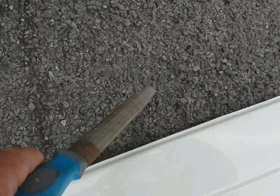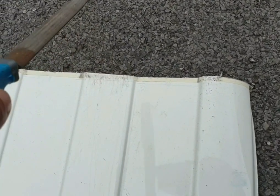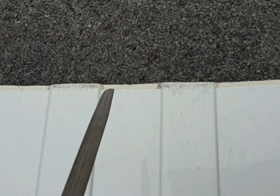And then it was 60 millimetres from the edge of the inside gutter in all the way around. Because this is a long wheelbase version, you don't take the last strengthening beam out at the back of the van. So on the rear, you come back in 16 inches from the rear of the van, find your centre point and go out. But that would leave the last strengthening beam in at the back, so that wants to be cut tight up to the strengthening beam.